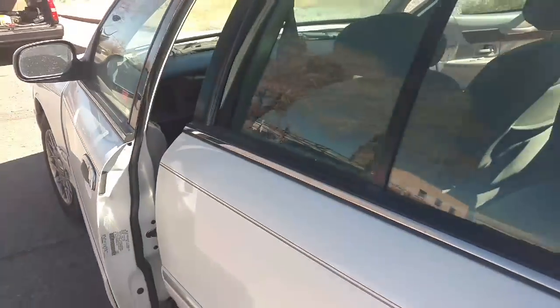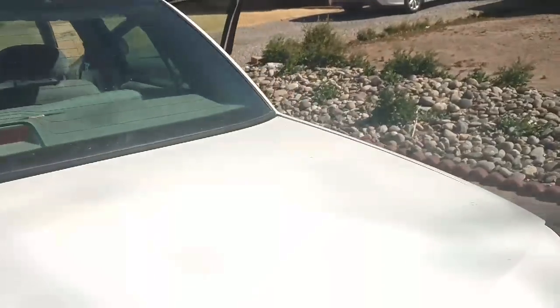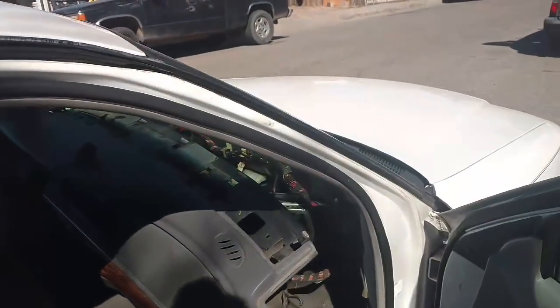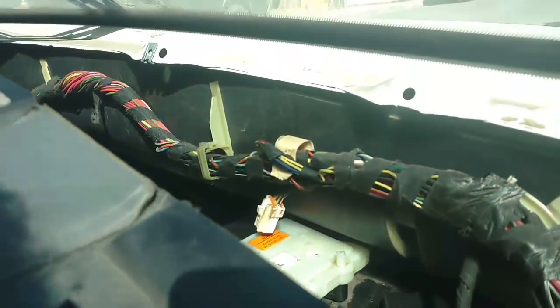So anyway, this is probably a 2-man job. 3 helps, the last guy said, but 2 will probably do it. I'm hung up right now because the heater core box is held up by 3 nuts, bolts that come through the firewall. 1 up here and 2 down below.